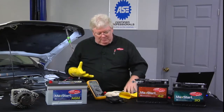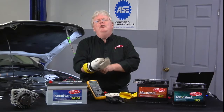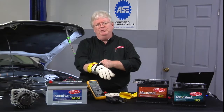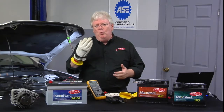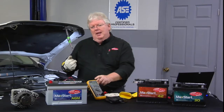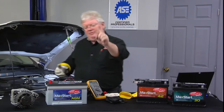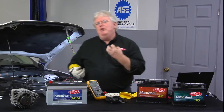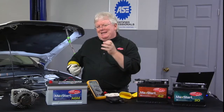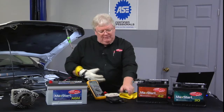And every time you use them, check before you put them on and after to make sure you didn't poke a hole in them during the service process. The rubber gloves go on me and protect me from electrocution. Anything over 60 volts, even under an amp, can be injurious or lethal — can take your life. So I power the vehicle off, disconnect the 12-volt battery, remove the big orange high-voltage battery service plug, and then the gloves go on.